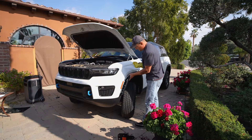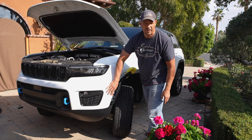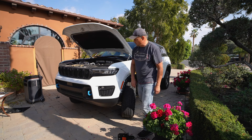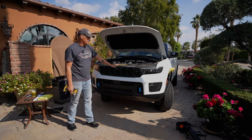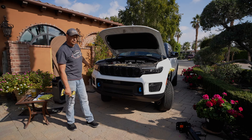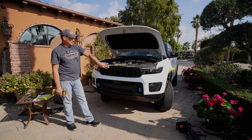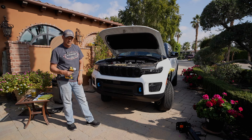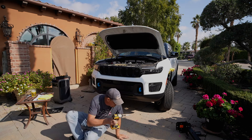We got the same thing done on the other side — just stick a rag in there to keep it away from the fascia so it doesn't latch on when we're pulling it out. We've got the bolts and screws out of the top and sides of the fascia and pulled back the trim. Now we've got the nine 10 millimeter bolts on the bottom. So get underneath the Jeep, get on my back, and pull out those nine bolts.